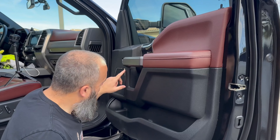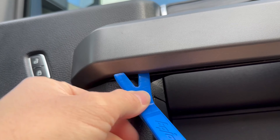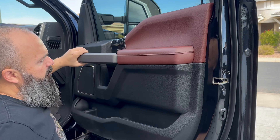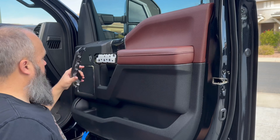To get our grab pull handle off, there's a small little opening on the bottom to get your trim tool in and then you can pop it off. As you're popping that off, your retainer drops in on this side — you don't want to pull this side out or you'll break that plastic tab holding it in.